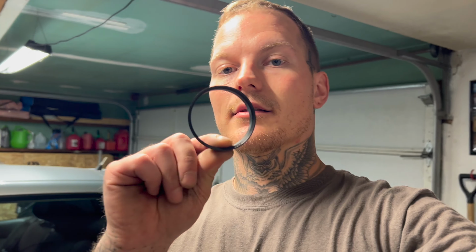all because of a couple millimeters of gap. So yeah, if your hubs on your wheels are bigger than the hubs on your wheel bearings, definitely get hub-centric rings. These things are, I mean, yeah, it's a little piece of plastic, but it'll save vibration. It'll save you from almost losing center caps, if not lug nuts. You don't even want that happening to you. So highly suggest it.